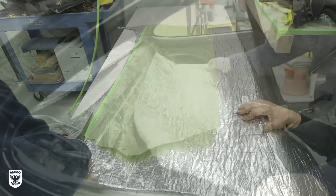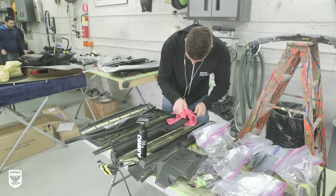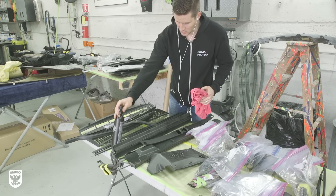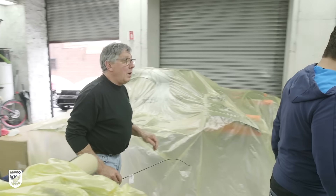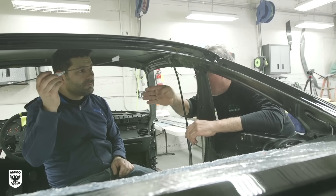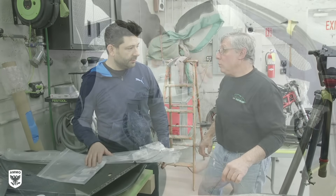With the new roof installed, the metal inside needed to be primed and painted to avoid future rust, then the base coat was applied by can and allowed to dry, followed by the final color coat — a precautionary step since the headliner will cover the roof, but avoiding rust is imperative when living in the northeast. With the roof drying, George cut out soundproof material for the floor using a stencil he made for each area of the interior. George also needed advice from Frank about the metal hangers that hold the headliner to the roof, as the aftermarket piece required cutting and reshaping the wires to match the roof.